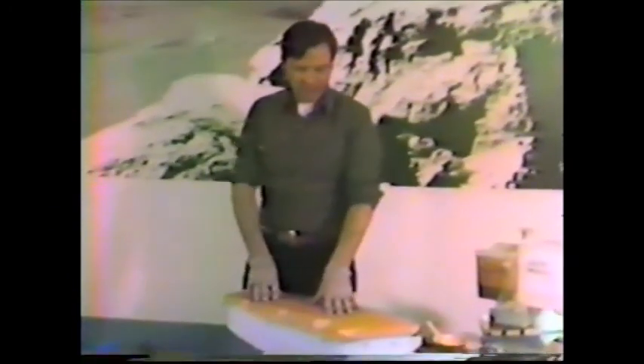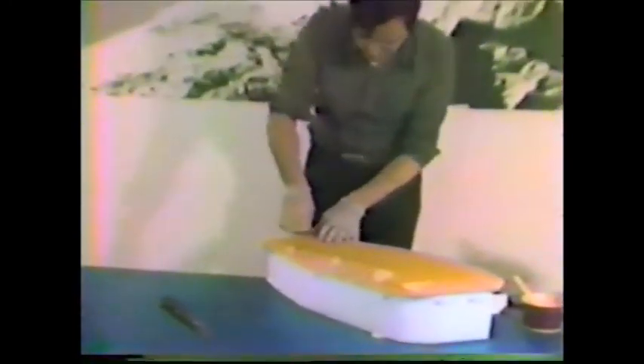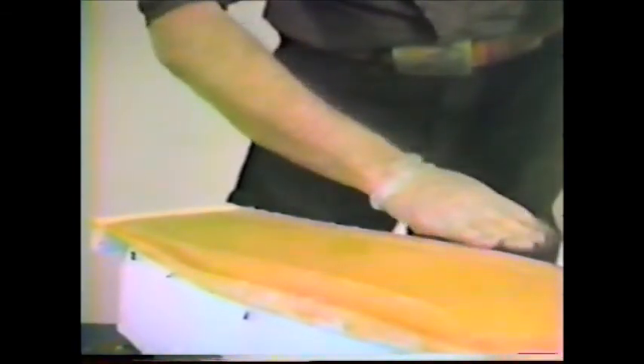It's at least a day later and we have a full cure on the surface and skin. We take the peel ply and get under the edge and remove it, revealing the nice micro fill. We remove the peel ply around the edges also because the next job is to glass the other side and we'll need to lap onto those. The peel ply on the inner surface is removed only just before the entire winglet is mounted on the airplane, as we need to lap up onto that.